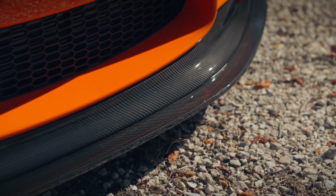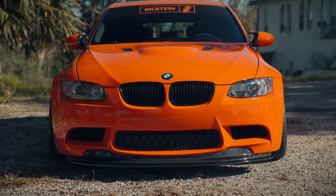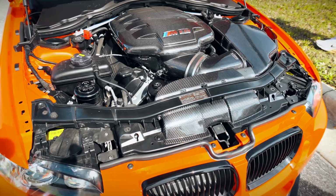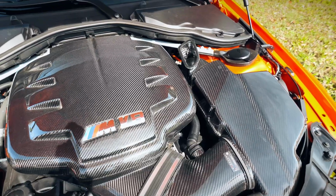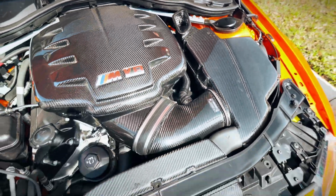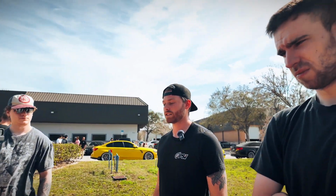So the OEM fenders mount directly onto the 328. So it's OEM front bumper, OEM fenders. We had to add some of the mounting brackets to make it extra OEM. But subframes, rear and front, both come straight out of the M3 donor car, plug right in. Cool thing about those specifically is we repowder coated them to OEM standards, cleaned every nut and bolt on all the subframes to make sure this is basically a brand new car for anyone that gets to own it down the line.